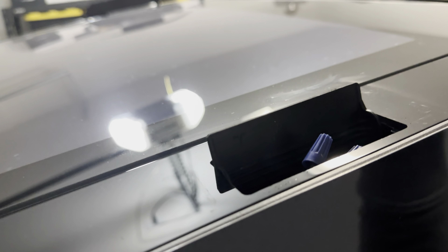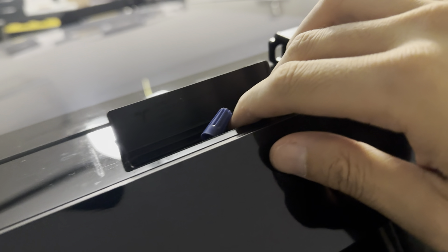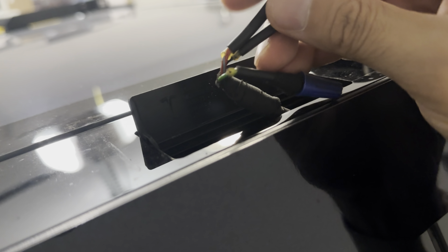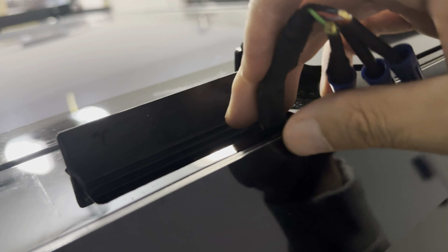For the right side, there are wires in here. You only need to pull out the red and the black wire — do not connect the other wire. So just red and black, not the green one. When you install the bracket, put the wires to the side.